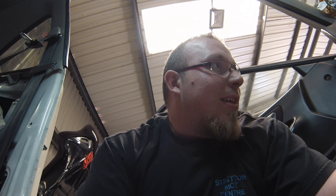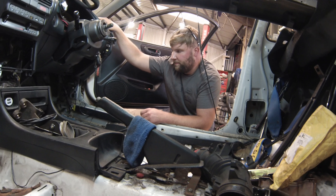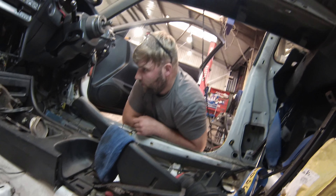He's done some of his wiring. Badly. K-swap wiring — done a shit job with this ghetto labelling system, even though it's all in the instructions. The only thing I've not done yet is the fuel pump. I don't think I've done coolant temp either. That's easier though — straight to the bucket. And there's the brake warning one — something you push through and then stick onto the top of the reservoir. Do you need to do that? Not really, unless you want the brake reservoir to tell you it's low. If it's not connected at all the light would be on.